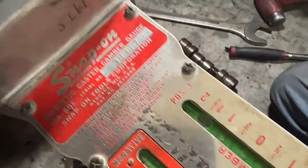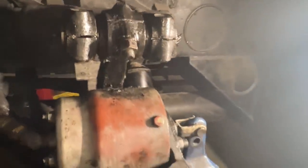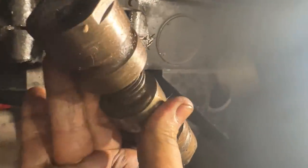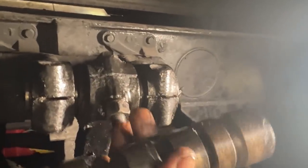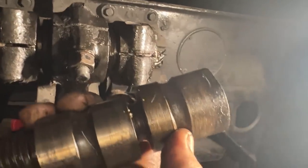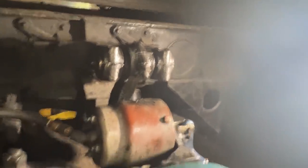So we're setting the camber here. And in order to do that, as we turn these outside pieces, I'm going to hold that up, Tony, and show them how it's, so the middle one is not centered in there. So as we turn it, it rotates and either swings in or out with the outside arms there. And then we get it set and we lock the middle in and then we can adjust the other ones back out to get the bolts to go through the holes so it can't ever move. But now that it's set, it won't. We just gotta put the other bolts in and we're good to go.